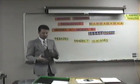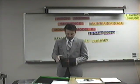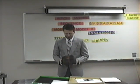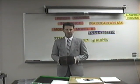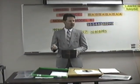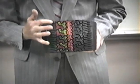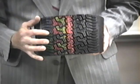Okay? I'll show you that in a second. They also sent me a chunk of the tire, and they ground down half of the chunk. If you look at the photograph, the outside rib has the sipes worn down about 50%. See, here's what the new sipes should look like, and the sipes worn down 50% like that. That's what they're like in the plaster cast.